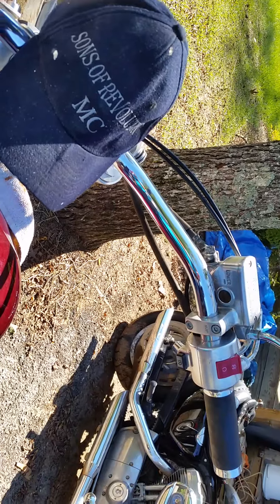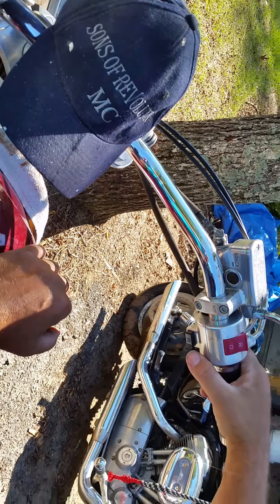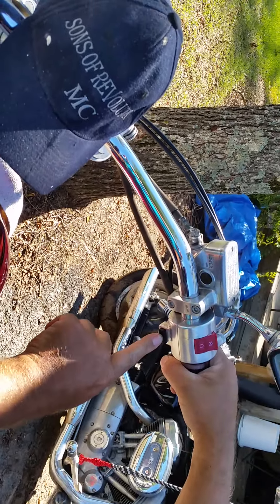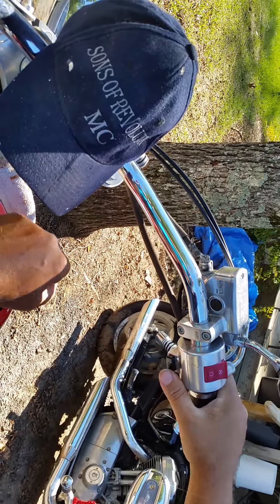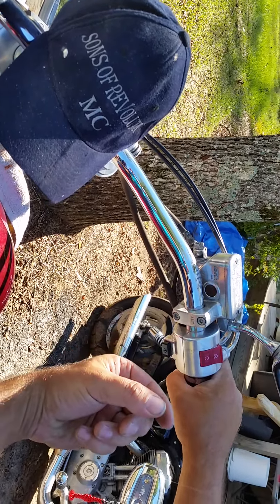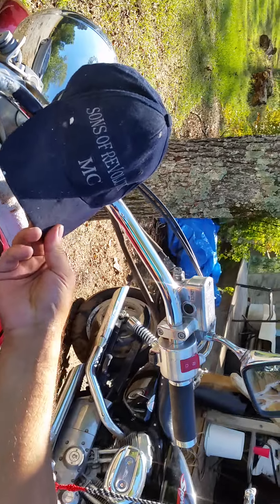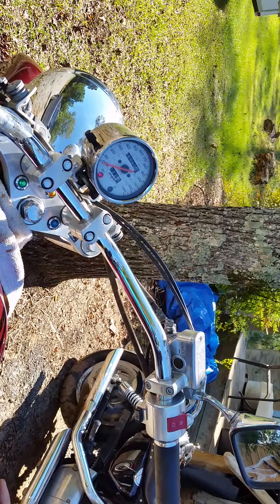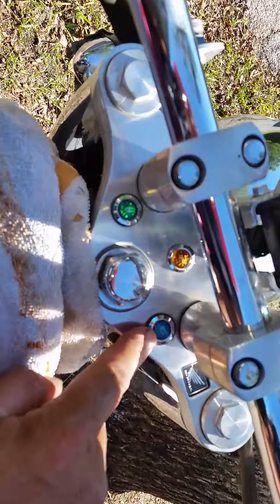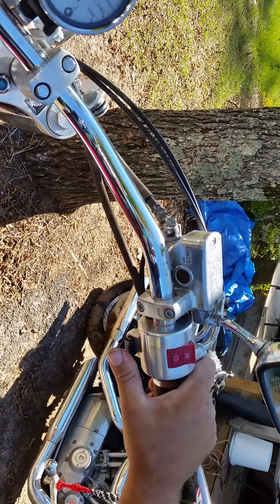When I first put this back together I was getting no connection. I think what happened is when I cleaned the contact, I pushed a little too hard and bent the prongs. What I did was bend them up a little bit to make a good contact. Now as you can see, when I turned my key on I got my bright light on and I have a signal showing that my headlight is working — which it is, because I went around and checked it — and my key is working every time I hit it.